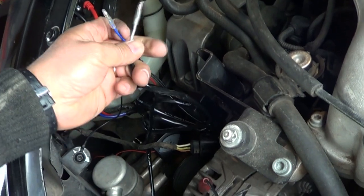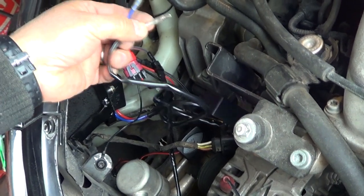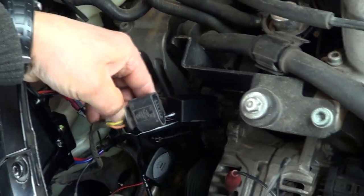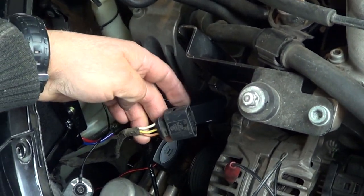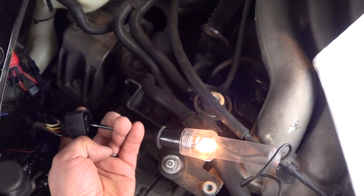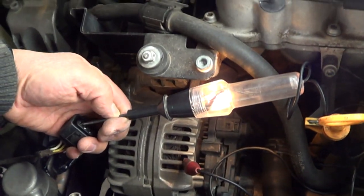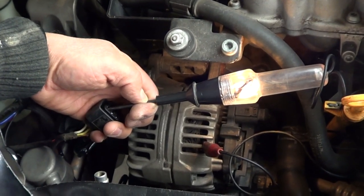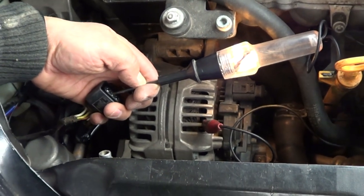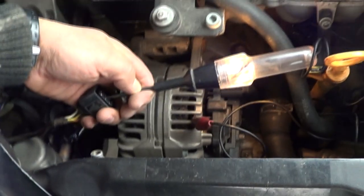When I was testing these lights outside the vehicle, I was applying low voltage to find out which wire was which. The white wire is the low beam and the blue wire is the high beam on the aftermarket lights. I need to figure out which wire is the high and low beam from the OEM harness. With the key on and low beams on, using the circuit tester, the yellow wire turns out to be the low beam. So the white wire is the high beam. Here's another cool thing about this car: when the high beams are on, so are the low beams, which means both the high and low beams will be on with the HID lights — giving us great visibility.